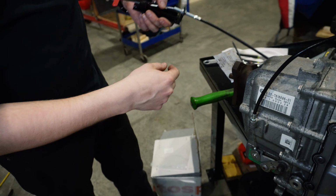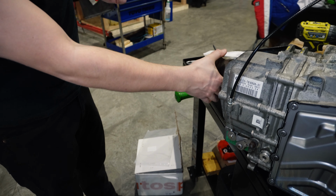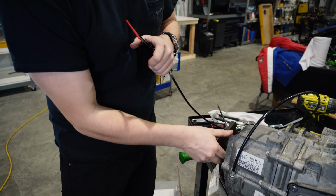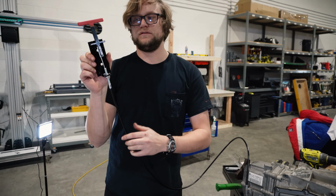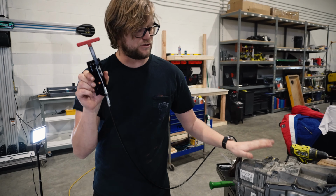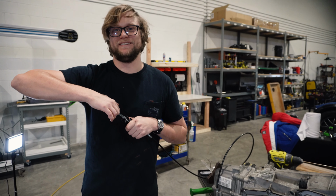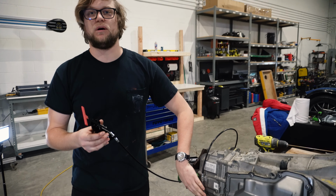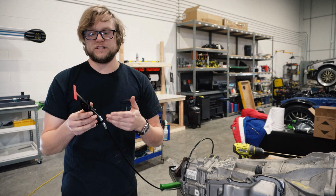But now that we have all the slack taken out, see right now, we're in park, the engine is off and the car automatically goes to park when it loses the pressure. Now, let's grab this. Wow. It rolls. So, if you want to force a neutral, you can pull it to the top position. This position is also good if you have a race car and the engine fails and you don't want it to go into park, you can leave it right there. If you want park to still function, like you trust your motor, you didn't build in your garage, maybe you still trust it. Maybe you don't drive a BMW. Yeah, you can leave it in this, and the transmission can then go into park and neutral on its own. So this system gives you both options, which is why it's so nice.